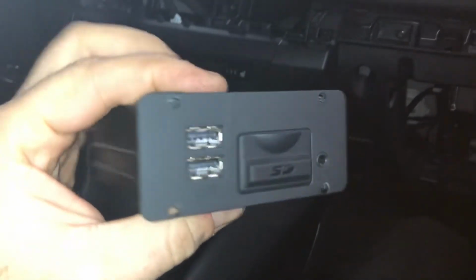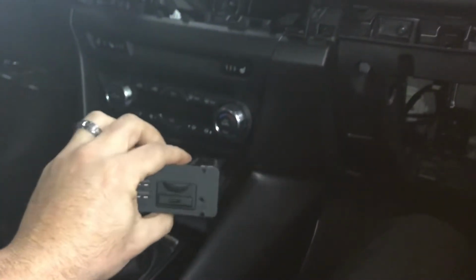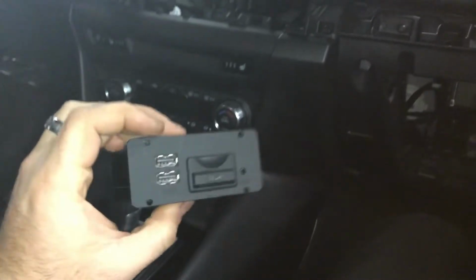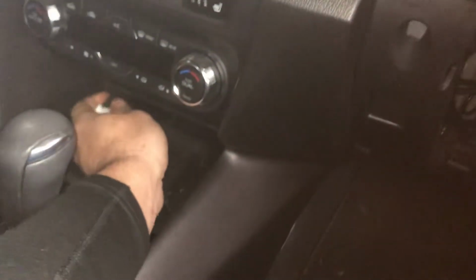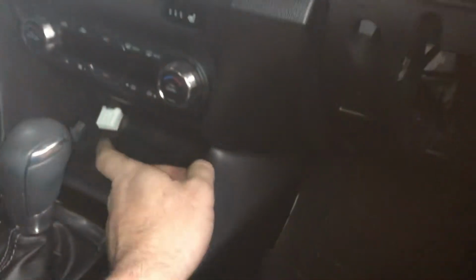And after I got all 4 of those through, I reached down, I wiggled on this thing a few times. I had a little pry till it popped forward. I was able to take the 2 connectors off the back. Those are just hanging out right there right now. And so now that's out of the way, I'm going to run my cable through there. And yes, if I just gently pull back on this, I can then fit, in this case, my right hand straight up to this point and grab this area. So now I can feed the new wire that comes in the kit from there up to here.